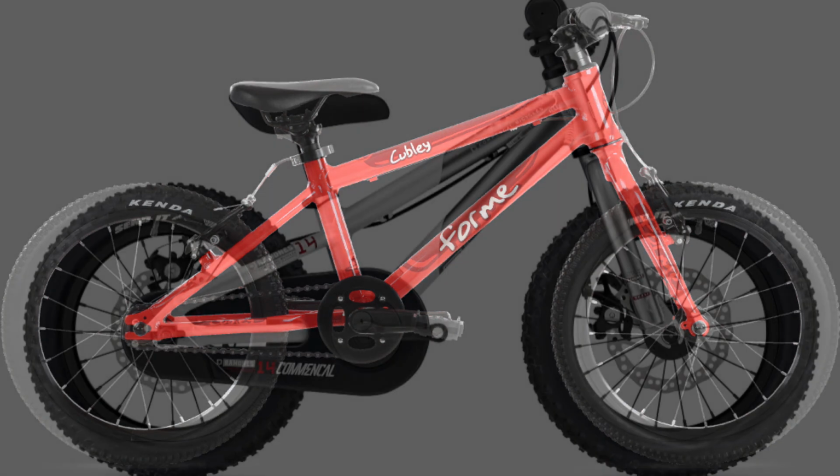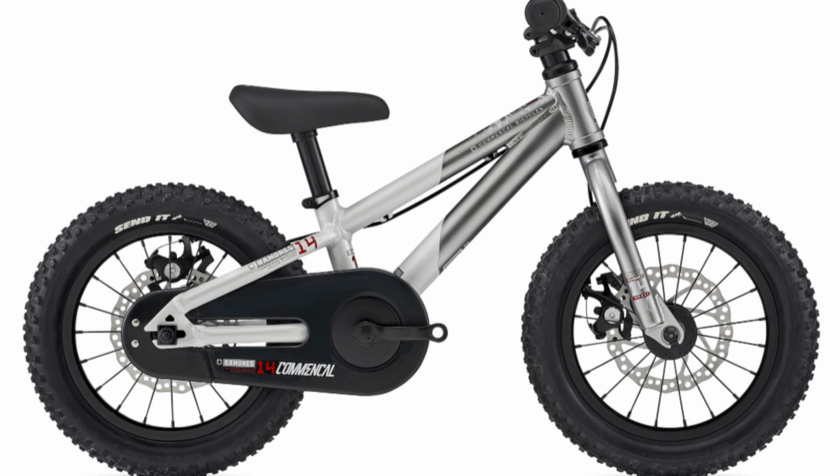Now also, look at this one. This little kid's bike has disc brakes, but you can see the front fork pushes outward. And it's the little welded gusset on the front of this fork where the front tire mounts. If you spin that around backwards, it moves that front tire back maybe an inch and a half. In a lot of ways, so what? But that changes the balance of the bicycle. It moves that front wheel a couple inches back, and this little kid's bike has these great big disc brakes. So the kid's trucking along, you've got that fork on there backwards. He tags that front brake, just pulls it really hard, and gets launched right over the handlebars. So it changes the balance of the bicycle.